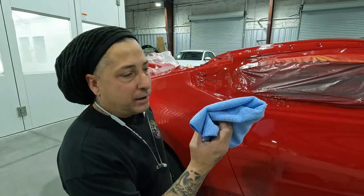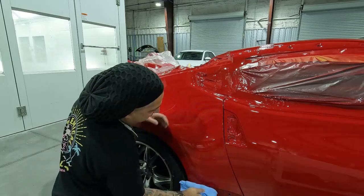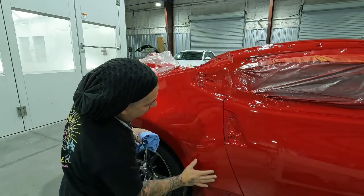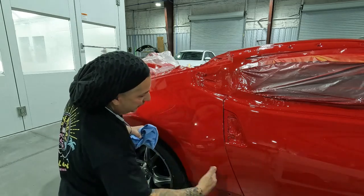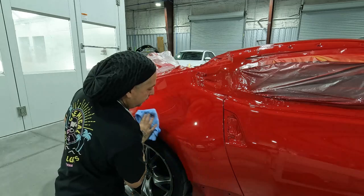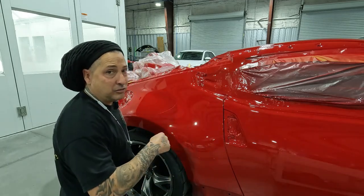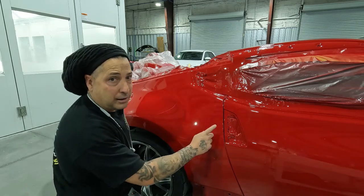Make sure you have a new rag when you're wiping off your polish — don't use your old rag from the compound. I took that further just to blend it in so this whole area is going to look the same. You don't have to go further because you're stopping it almost like you would do a blend on a job. This is it — we wipe it and that's the finished job right there. We'll finish that around, then we'll unmask it and I'll show it to you all done in the jams — unmask how our edge turned out.